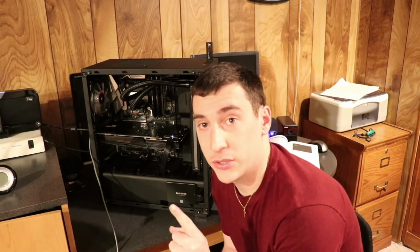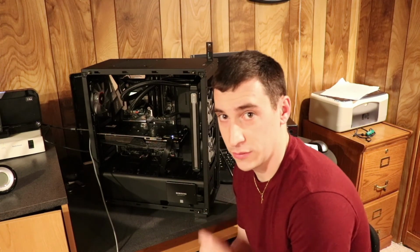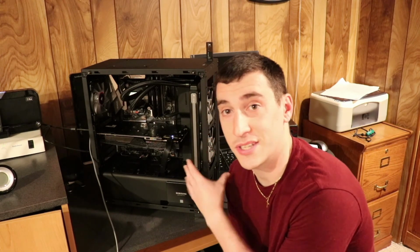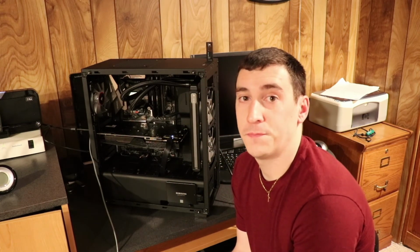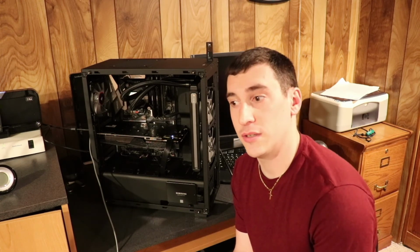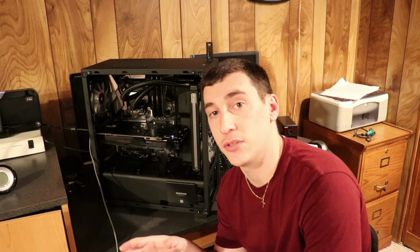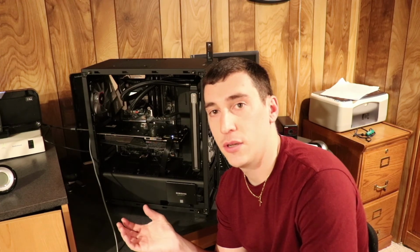The one thing I will mention right now is the H100i V2 from Corsair in the NZXT S340 Elite, or not Elite, because I think the dimensions are pretty much the same. It's more so just the side panels. It kinda sucks to put in there. Corsair made this to be installed as exhaust, and I didn't want to do that. I wanted to put it at the intake. The instructions only show putting it as an exhaust, and only as a push configuration instead of a pull configuration.